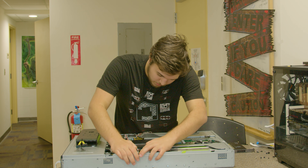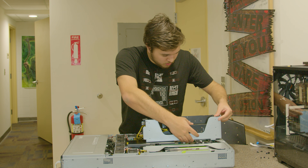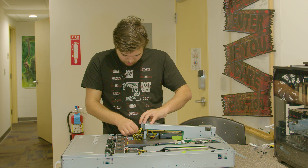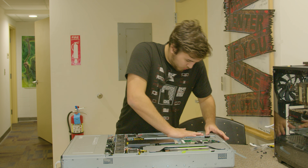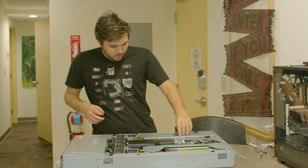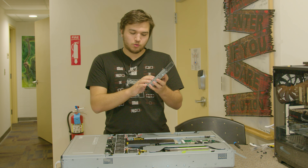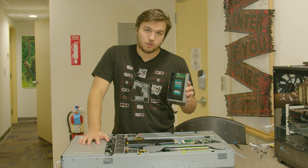Let's move on to the other two, which will actually be slightly easier. I'm going to put my P4 in the top slot. As long as enough airflow gets through our cards it should be completely fine. I do wish I had the proper bracket for it, but it's really hard to find one that's not from China where the shipping times wouldn't take a month and a half. For our boot drive, we have a nice hot swap bay in the front with an SSD — a simple 120 gig Inland Professional drive. Obviously I would use a better one if this was going to a client, but it will be upgraded later because, although it does say professional, I can assure you Inland is not professional.